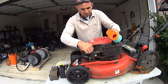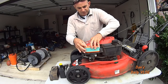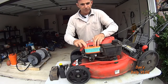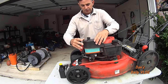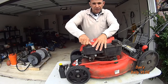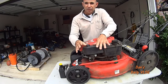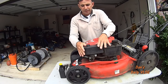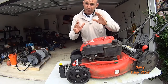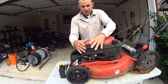It's that simple to do. You've got this big hole and this big hole here — make sure you don't have any debris and put your new air cleaner back on. It should be a nice tight fit. That is how you replace your air cleaner properly on these four-stroke motors. Make sure you read the instructions on the back of your air cleaner — if it has a pre-cleaner, some might say to lightly oil it, some might say don't. Pay attention to that.